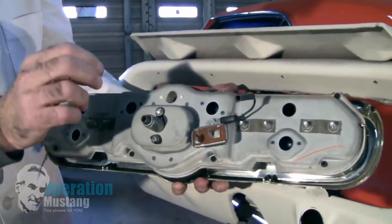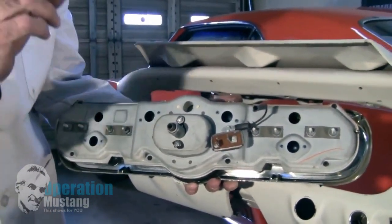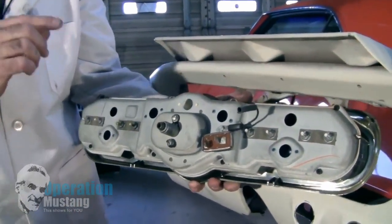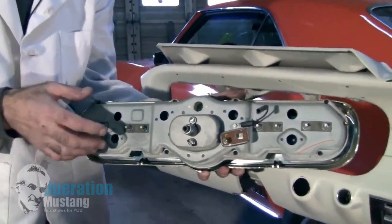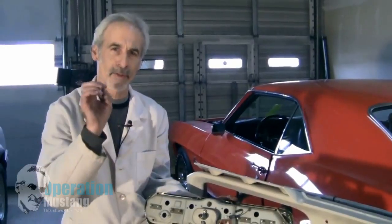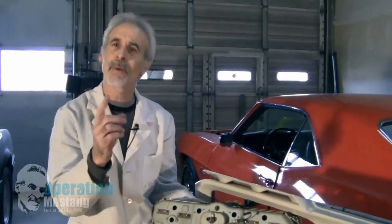The reason why they want a pulse of current is so if you take a turn real quickly with your car, the gas gauge won't just fly up. A lot of GM products do not have voltage limiters, and that's why on a GM car like this old Camaro I'm working on here, if you take a turn too quickly the gas gauge flies up to full or down to empty — because it's getting the voltage too fast. Ford figured out that a pulse of current allows it a little bit of time to lag around and won't be so sensitive.